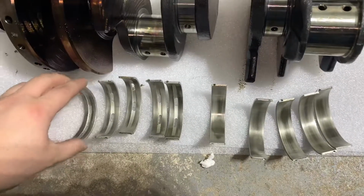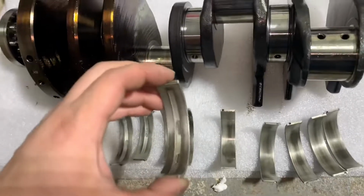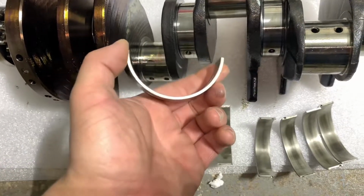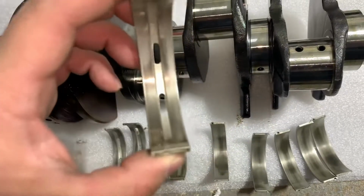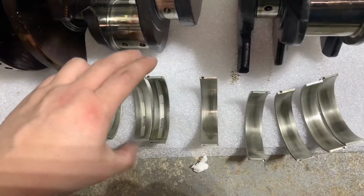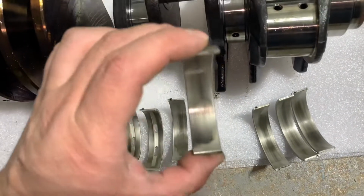About the bearings, this is the crankshaft bearing. They're pretty thick. I think that's the difference between S6, S7 and RS engine. The thickness of the main bearings, they're pretty big and thick. And same thing, you see, it's worn out a little bit. I mean, it's about to go. Maybe another 40,000 miles on stage 2, it will definitely be a problem.